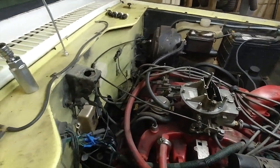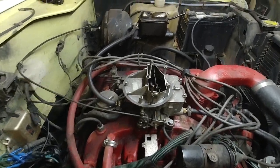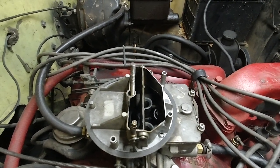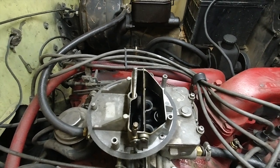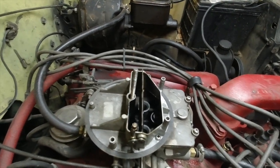And what we found was two plugs that were fuel fouled. So we need to go right after the root problem, which was that after the vehicle is shut off when it's warm, it continues to dump fuel down the venturis. So there's two things: either we have a float that's bad or saturated, a needle and seat that's not seating, or just a high float level.